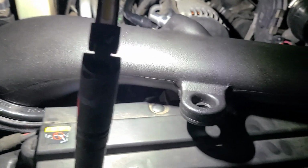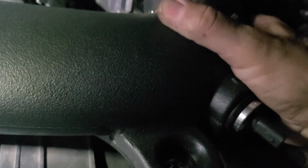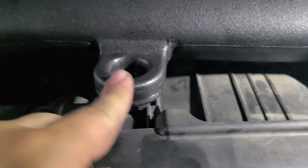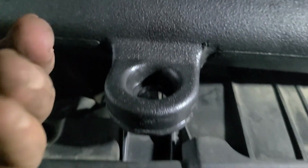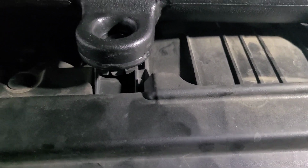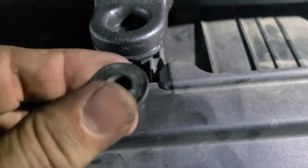Shouldn't be too bad. So start at this end, align those mounting grommets down there. Make sure they're aligned. Make sure this is well aligned here. You can rotate this guy out of the way until you're ready to put this silicone coupling back on. So let me do that. Close. We're going to reuse the original grommets from the intake. You have to feed the rubber part through first and then put the metal spacer through the hole. Okay, mounting screws are back in.